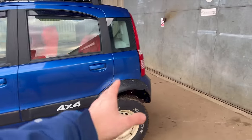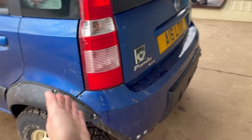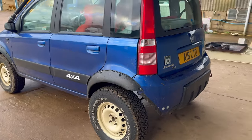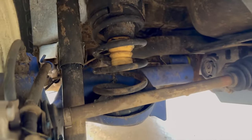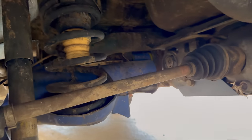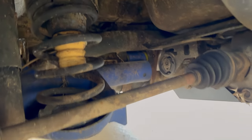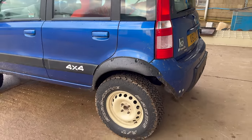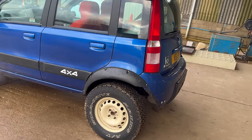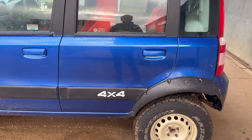Around the side and rear, it's similar to the front but for clearance I had to do a slash cut and cut some of the rear bumper away for the bigger wheels. There's a lift kit on the back as well — basically a rubber doughnut that sits on top of the spring, giving roughly a 30mm increase at the rear. The rear arms have also been poly-bushed. If you're replacing the rear arms — which is an absolute pig of a job — definitely get the best quality poly-bush kit you can, because you don't want to pull those arms off again.